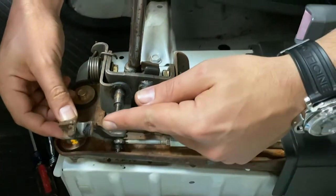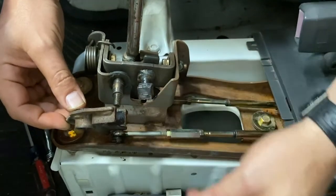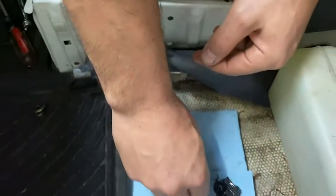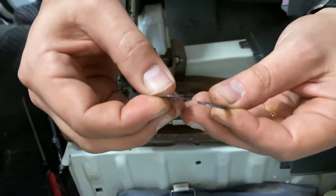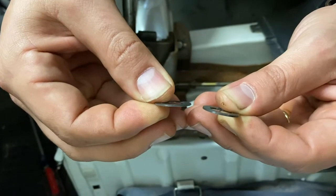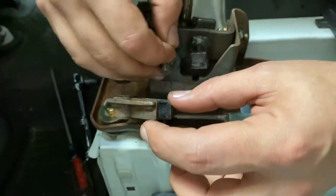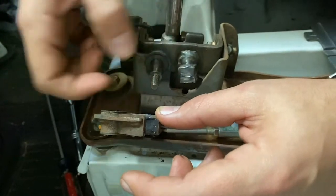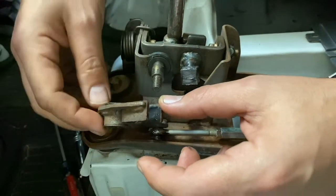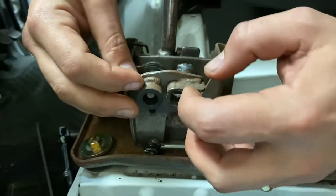So the cup is greased up. I put a little grease in the jaws right there. This is the part where the shims come into play — you can see there's one thinner, one thicker. You can kind of play it by ear, but they slide right on the shaft, and that's just so you can tighten it up a little bit more. Slide everything back together.